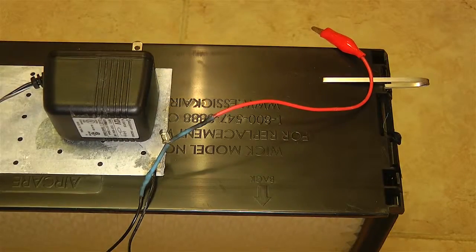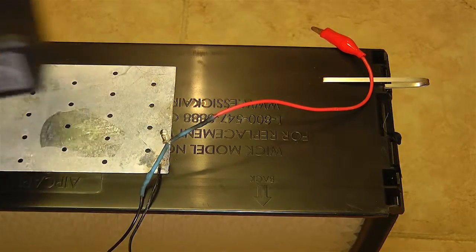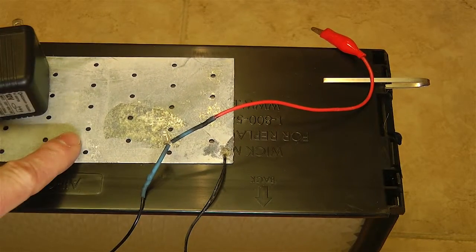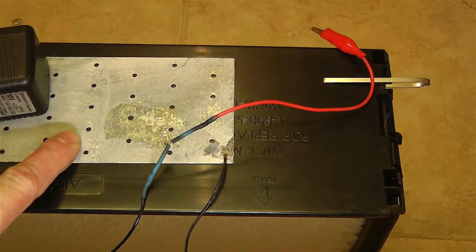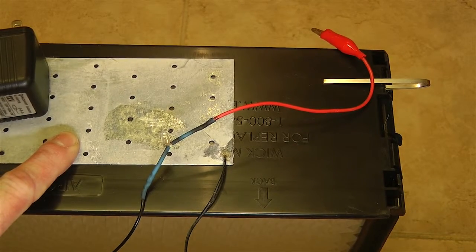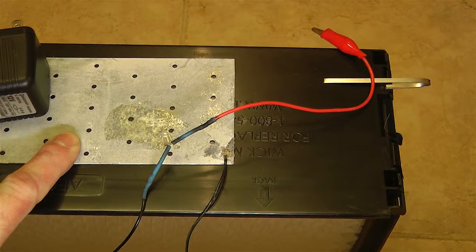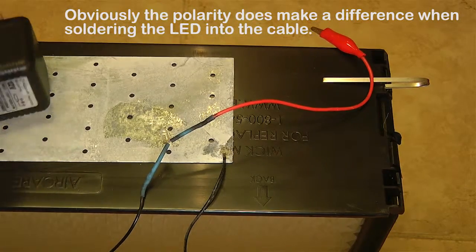So the three components that make this possible are the power supply, the electrode plate, and sometimes this is the cathode, sometimes it's the anode, doesn't matter how you connect the polarity for this thing. If you were doing a plating operation, sure, but you're just adding two electrons to a hydroxyl to free the calcium up. So it really doesn't matter the polarity of the power supply.